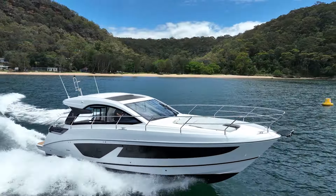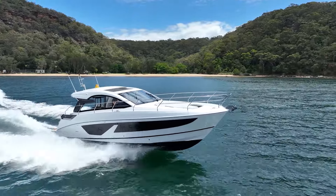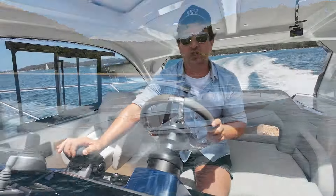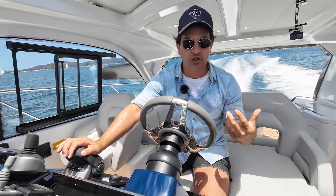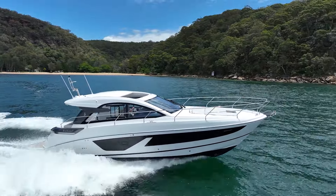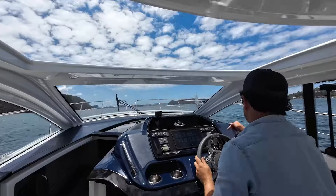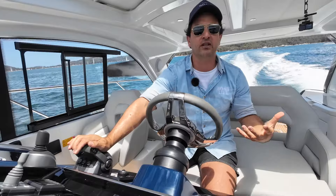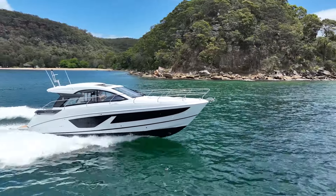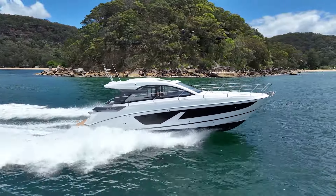That's a lot of fun. Now that the boat is up and running, this is when you can set your engine trim for best performance. I'm just going to do up on the leg trim a little bit, and now I'm at 23.2 knots giving me a fuel flow of 70 litres total — speed just over 23 knots. I can see the Zipwakes doing their thing. We're in mostly flat water, so we'll play with this along the flat and then go find a couple of waves.